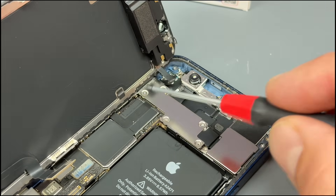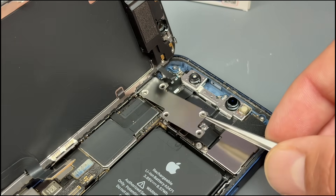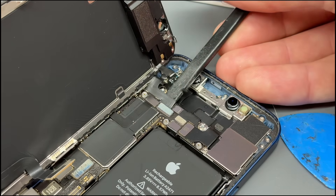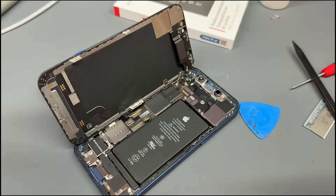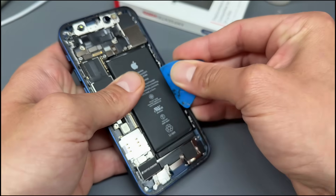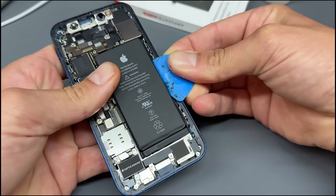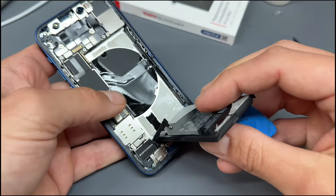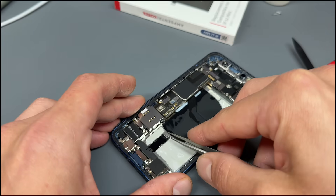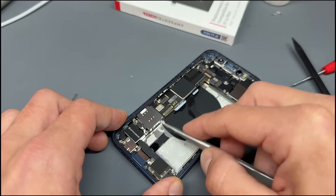You'll know exactly which shape I mean on Tetris. Maybe we'll get Alex to put a little animation of that Tetris shape. I'll disconnect this cable, and now that that's been disconnected, we can remove the screen — put it to one side. That should have left us enough time to get underneath this battery with our prying tool and just pop this battery out. The alcohol will have soaked under the battery. You can see where it's got to and it's done what we wanted it to do. Before I started this video, I made sure that the software is up to date, so when it comes to it, we should be able to recalibrate it.